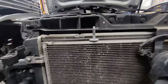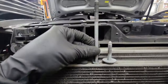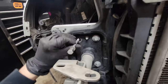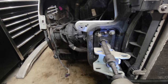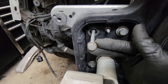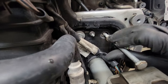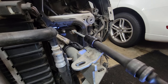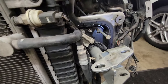Now let's say you're like me and you like to save a bit of money. Here's the bolt that came out of here. Let's say you don't want to buy a specialty tool — here's the bolt that came off of your bumper support. See how it's the same thread pitch? That one bolt you just took off — go ahead and put this one through it. Run it to the end of the threads. The specialty tool you have to order for this just allows you to slide the core support — the front carrier — forward, so you get enough room. By using these bolts, you eliminate the need for that tool. That tool is at least 70 to 80 bucks, and if you bend one of these bolts, you can easily buy one at your local dealership for much less. Put those in there just like so.